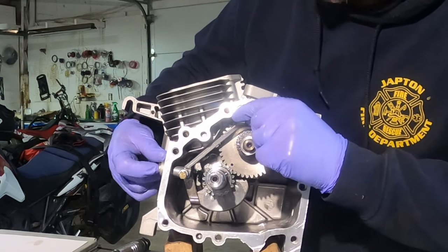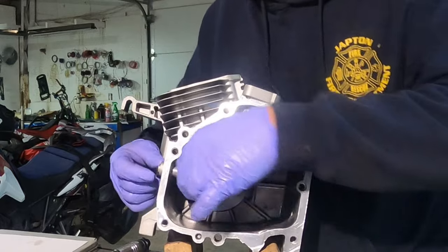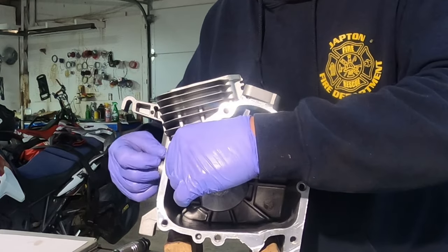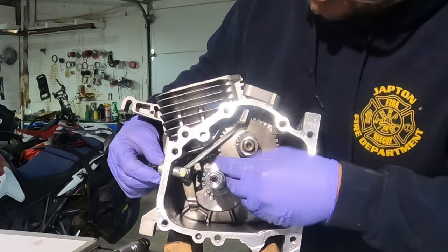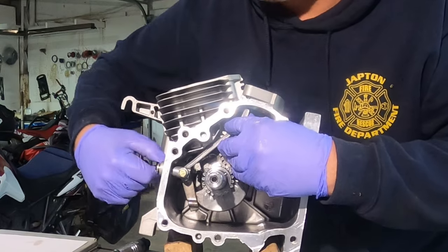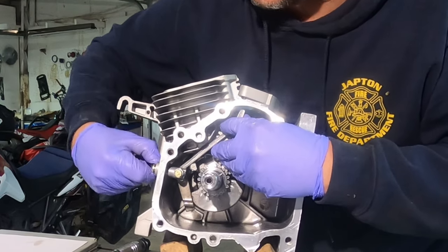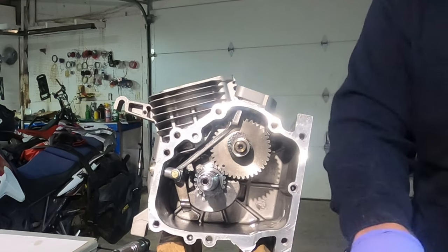Now that I've got it close, I'm going to be operating this governor arm. It is in the flat right now so we can go ahead and tighten it down — you should feel it getting flatter and flatter and less movement. See, the arm cannot pull in or out at this point. It can't be pulled out of the case, so I know that we're inside the recess in that pivot arm.